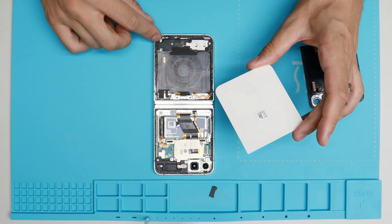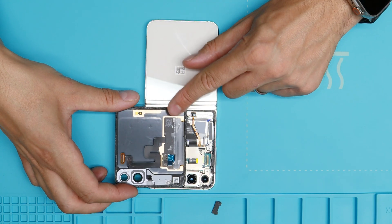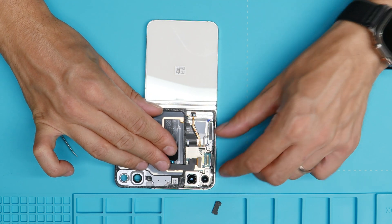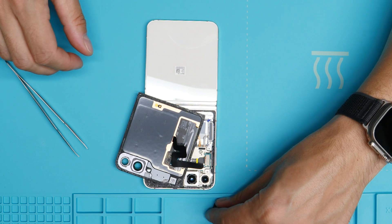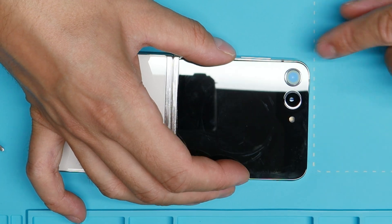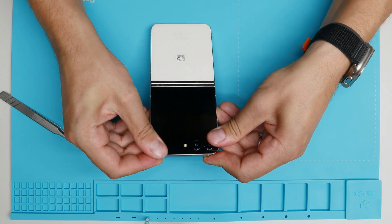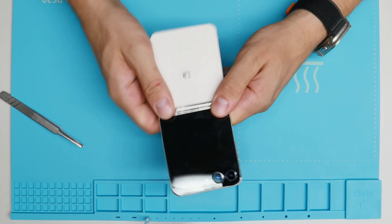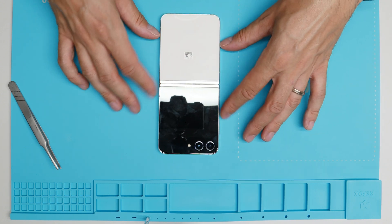Putting back the bottom plate and now the top one. Do it like this — put it here, be careful of the main camera, then you can just flip this like this and put back the holder. Align the top display slash back cover. Now I will heat up the device again at 90 degrees for about 3 minutes. We have special clamps for this — put it in clamps so the glue gets strong and then the back cover or display is really tight and tied back to the frame.